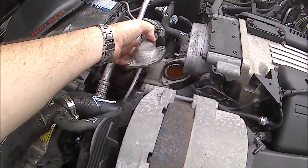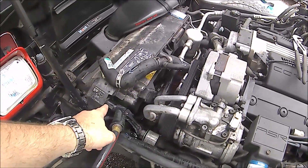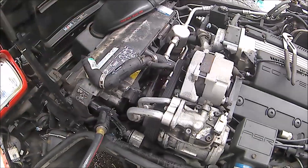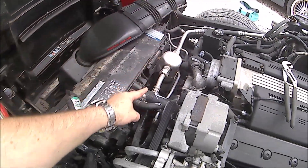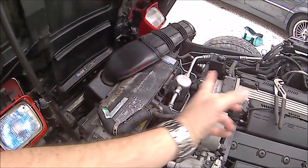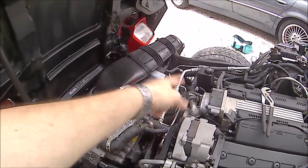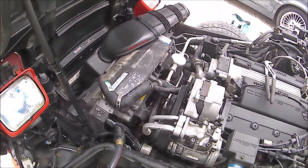So we got just a gasket here. What we're about to do is put those two 8mm bolts back and then close the petcock and force water into the radiator with the hose. What doesn't come out of the petcock - it'll be closed - it'll go up that hose and into the water pump, and come out this hose and drain out. The heater will be on, the engine will be running, and the water pump will circulate everything through. Once we have nice clear water, we'll drain as much as we can again and then run the flush for 10 minutes to get as much stuff out as possible.